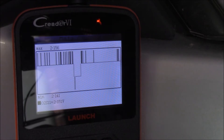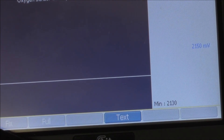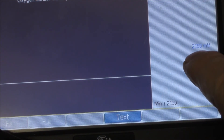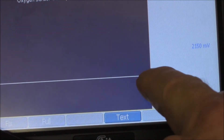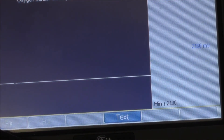What does the G-scan show? While it's not quite as obvious with the G-scan, we can still see the change being made. So let's grab that pin down there and my wire here. I'm now going to touch my wet fingers onto the signal wire going back to the ECU and my battery wire, using my body as a resistor. Keep an eye on this number here — we're at 2150 at the moment. Also look for a tiny change in this line here. You've got to make sure your fingers are wet.